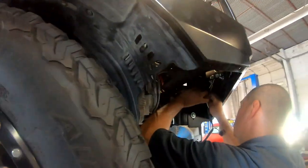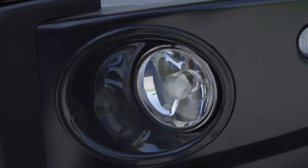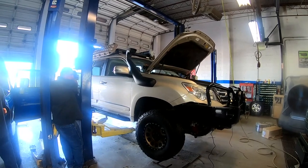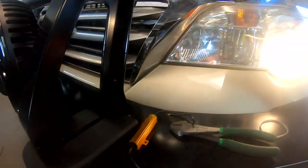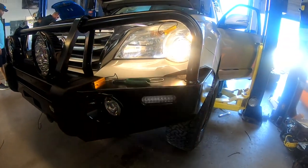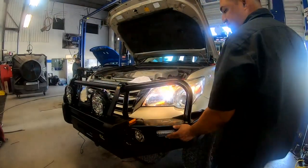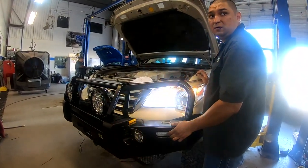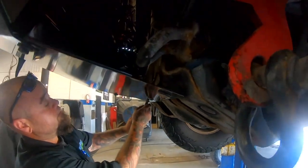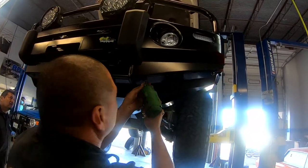The Ironman Classic bumper comes with integrated turning signals, parking lights, and fog lamps. We wanted the system to be integrated into the GX's OEM light switches. You will need to buy your own turn signal resistors in order for the blinkers to work properly. Otherwise, they will hyperblink. Truck Toyz got it right and all of Sandy's lights work perfectly. Justin and Angel bolted on the bumper's protective guards and completed the project.